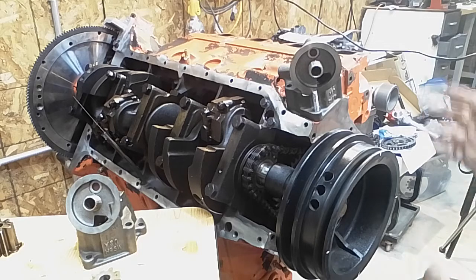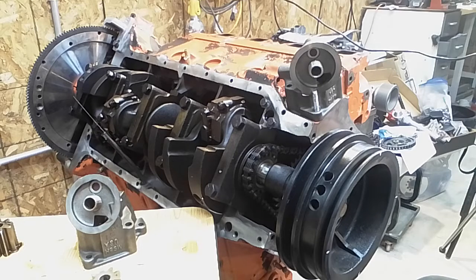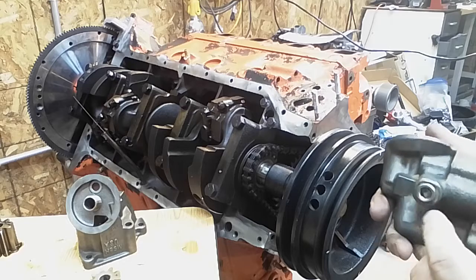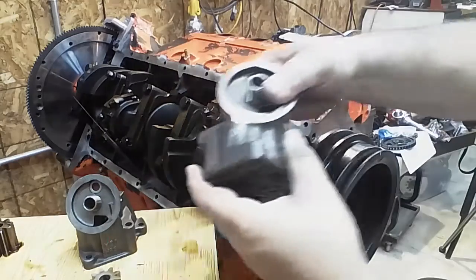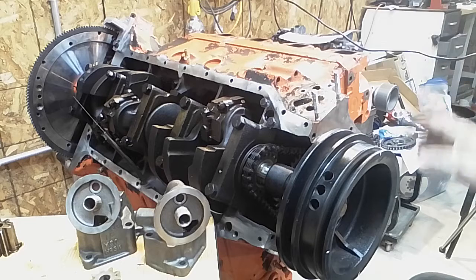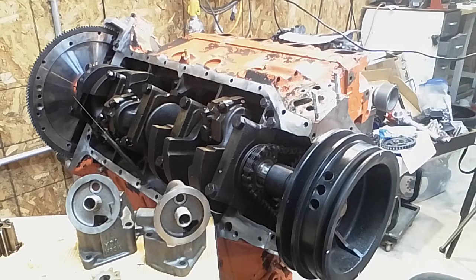Now, they're all basically the same pressure. They're all the same volume because they use the same gears. You can port them and maybe get a little more out of it. It's not going to be leaps and bounds. The only other thing you can do is this has a built-in bypass spring. Now the bypass spring will set what the pressure is when the motor is RPM'd out. At idle, you really typically don't move enough oil to be able to up the pressure, so it's not going to affect idle. But factory set pressure for a Cadillac is like 40 psi at a couple thousand RPM.